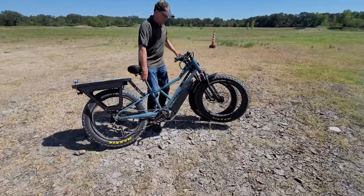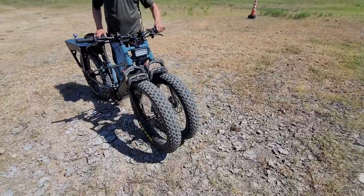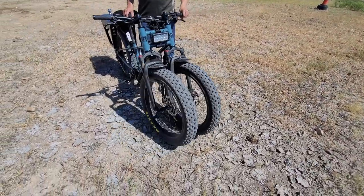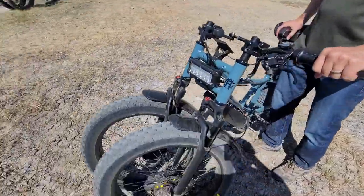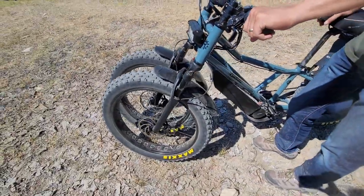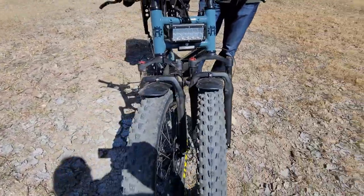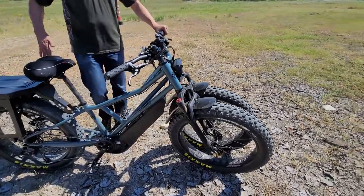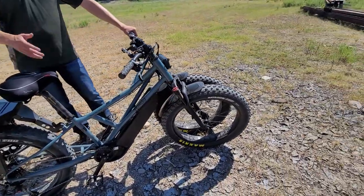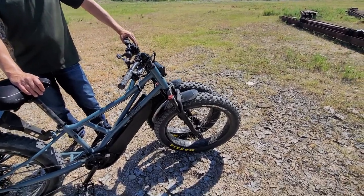The best view is with the two wheels in front. It looks pretty cool that way. So turn the wheels again? So this is a steering linkage that's just like what you find in a car. It's technically called Ackerman steering, and that's what keeps all the wheels turning on the same radius. That's what gives it the control. If you didn't do that, it would be really difficult to control on-road or off.